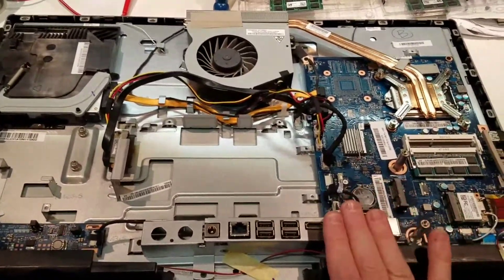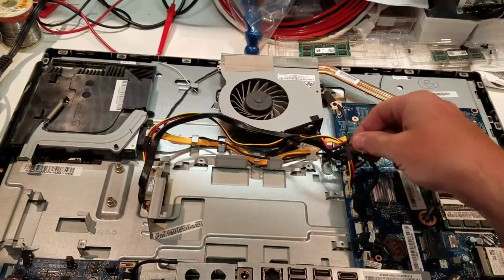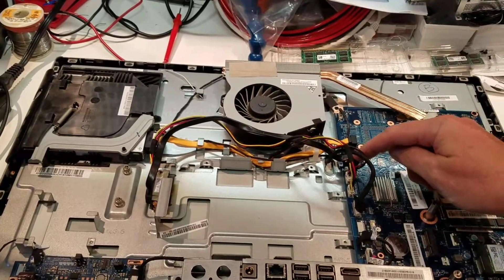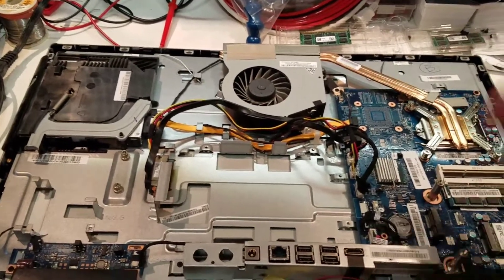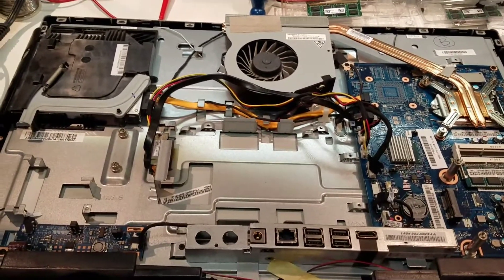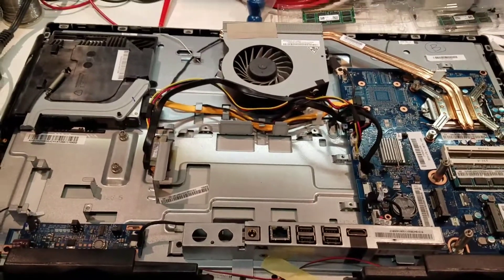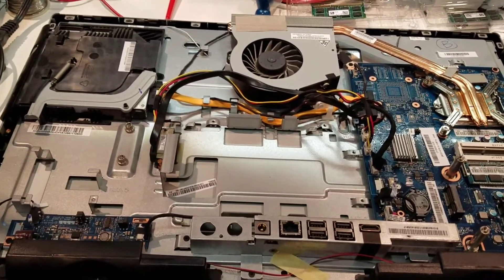The first thing I did was disconnect all of the peripheral connectors — the hard drive power and data connectors, the optical disk data connector, and both SATA data cables. As soon as I pulled those off and powered the machine back on, it booted up instantly and complained about not finding a hard drive with an operating system. That was great news — the motherboard wasn't badly damaged.